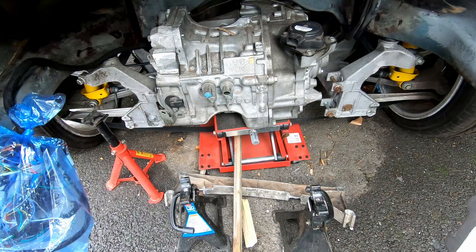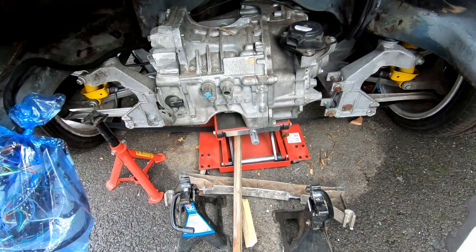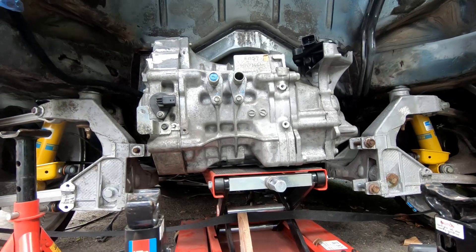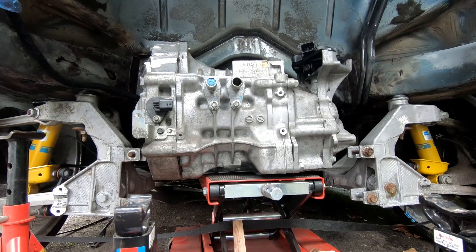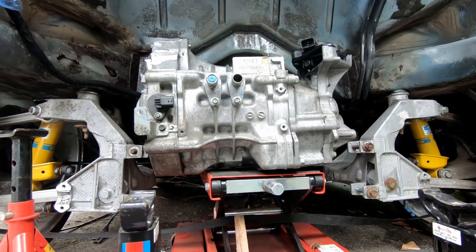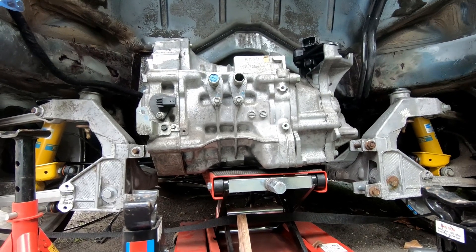The main change I've made here is I've removed the Leaf engine mounts. What I'd done previously was suspended metal brackets onto which the Leaf mounts attached, but they took up a lot of space and it wasn't a very secure mounting process. So we're going to go with something much more lightweight and much neater. As you can see, the engine actually sits really nicely between the two suspension subframes — you couldn't see this as well when we had it in previously because the mounts blocked a lot — but I think we can make use of how well it fits to make some really strong mounts that don't stray too far from the motor itself, giving us a lot of rigidity without having to play around with too much metal.